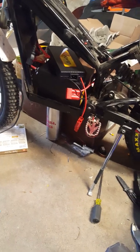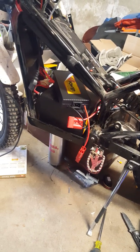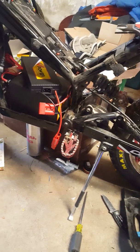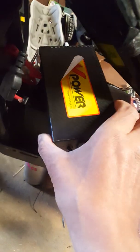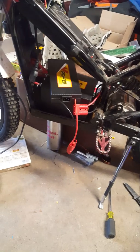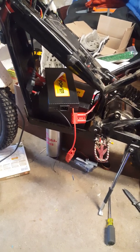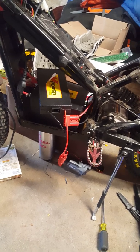I've got brushes and everything, but this one's a 20 Light — it's a 36 volt with a 1200 watt motor. I got these lithium batteries off of eBay. It was a custom order from China because the 36 only came with like a 15 amp BMS. These need about a 35 amp BMS.